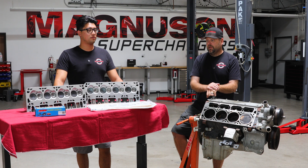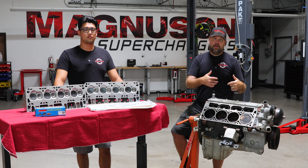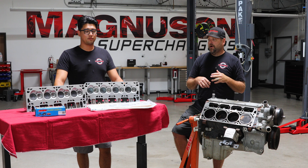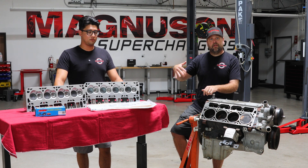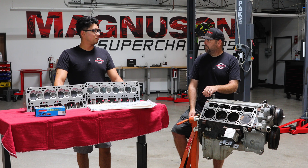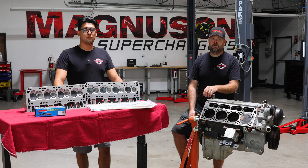The next step is new head gaskets, then the heads, then the studs. We're going to follow the ARP instructions on putting it all back together. The heads have also been decked, so we know they're perfectly flat — they were within spec, but they've been double checked so we know there's no issue on the sealing surface. I think we're ready to rock and roll. Everybody make sure to stay tuned because this giveaway engine is going out to some lucky winner, and in the next couple of episodes you're going to find out how to win it yourself.